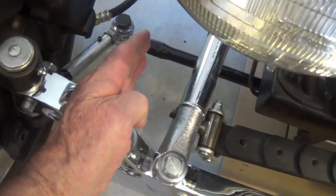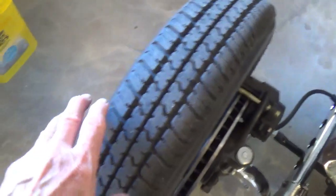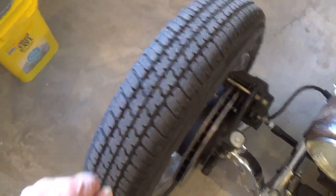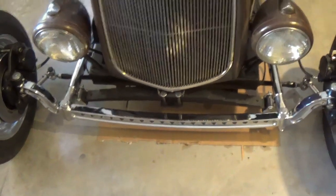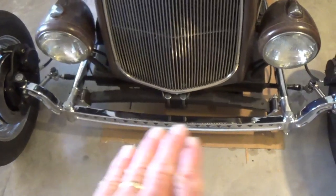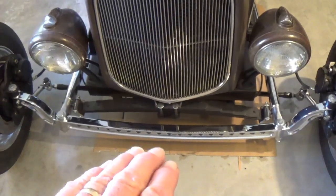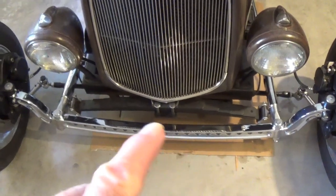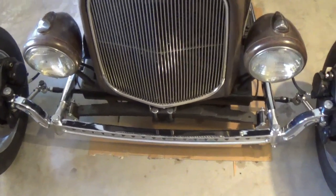What's really spooky is that as the front end is moving left and right, the steering arm here is not. So as it stays exactly where it is and the front end moves back and forth, the tires are being steered left and right. For some reason this doesn't seem to be evident until higher speeds — maybe the front end gets light at 55 miles an hour and that shifting can occur. It's pretty darn spooky at about 55 or 60. So here's my plan — I've heard of people putting Panhard rods on front ends and now I think I need one.